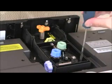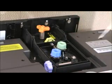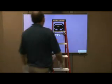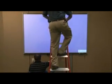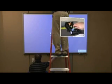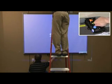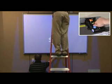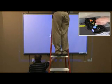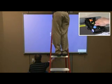While performing image adjustments, it is important to understand that every adjustment knob will impact the others. Therefore, after performing coarse adjustments, you will need to repeat many of the adjustments with finer care. The green knob impacts the pitch, or front-to-back tilt, of the projector. This impacts the image shape in a specific way known as keystone. In addition, this adjustment may also impact the relative size and height position of the image.